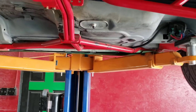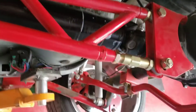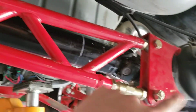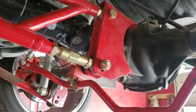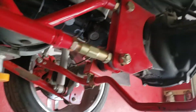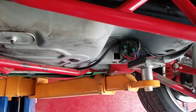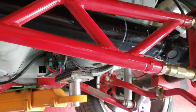To keep this video a little shorter, I was battling this vibration — like probably everybody else — messing with the pinion angle with the torque arm and all that. Brand new driveshaft, everything is new other than the rear end. It is a stock rear end for right now, just to get this car rolling. Anyway, getting a pretty nasty vibration under maybe 60–70 miles an hour.